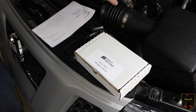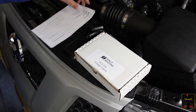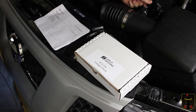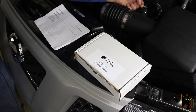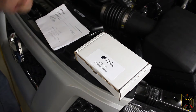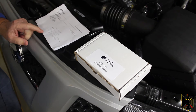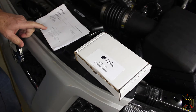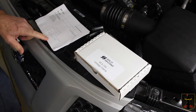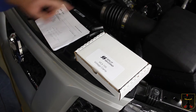I also took the truck to the dealer and had the ECU reflashed for the new software. I've taken some voltage readings between ground and the fourth pin — the first pin is blank, so it's the red wire. With no engine start it's 0.5V DC, at high idle 1.7V DC, at low idle in gear it's 1.35V DC, and at 6,000 RPM or higher it gets about 4.7V DC.